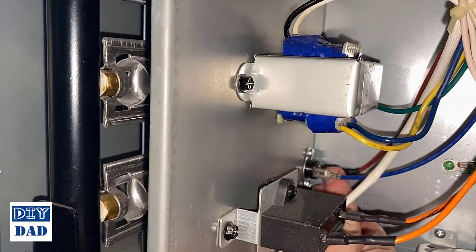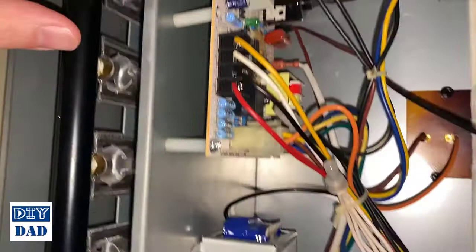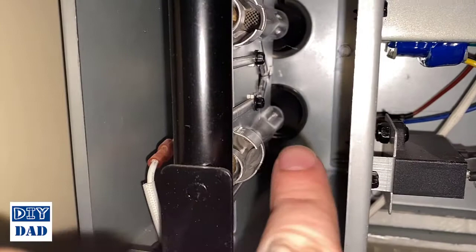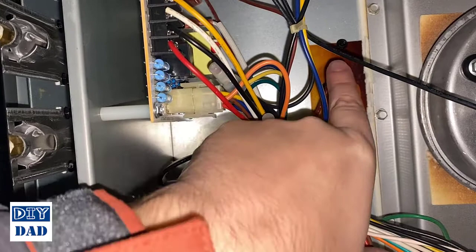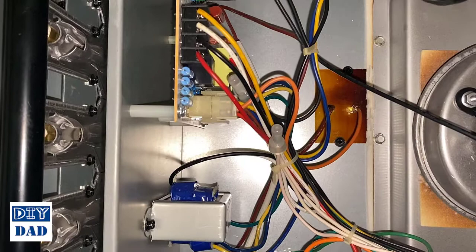The rollout sensors are mounted on the back wall — there's a button on the inside you can press and you'll hear it click if that's your issue. There's another one as well — you can see where the two brown wires connect on the back, those are measuring for temperature right there with the little pin sticking out. If it gets a heat spike there, it means flame is coming out of the tube and ballooning into this area instead of going in like it's supposed to — a very bad situation to get addressed professionally. The high limit sensor is this guy right here — just two screws and two wires.